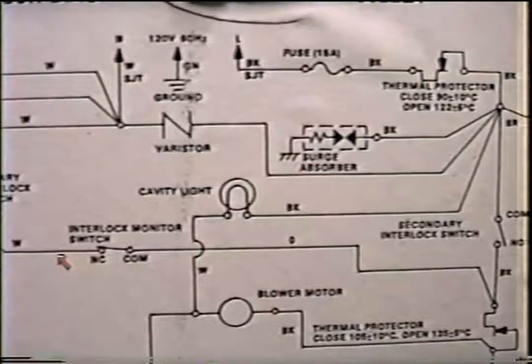Now, other things that could cause a microwave to blow fuses is maybe something in the high voltage. Maybe you have a bad capacitor or a transformer. A lot of times you could see smoke coming out of it, or you could smell a part. Sometimes if you plug it in and it just blows right away, or it's burning something that you can't see,